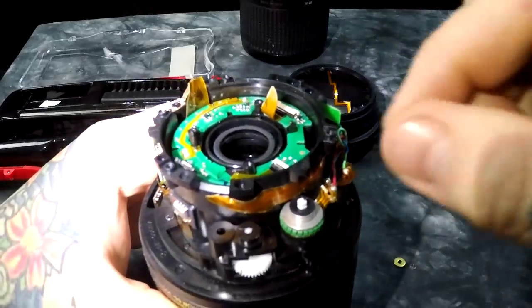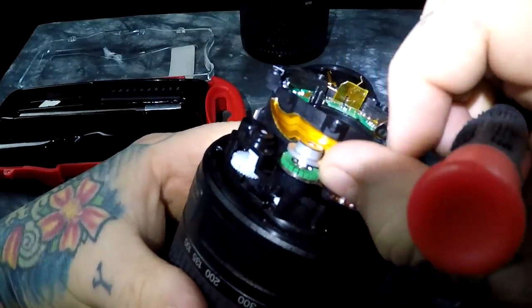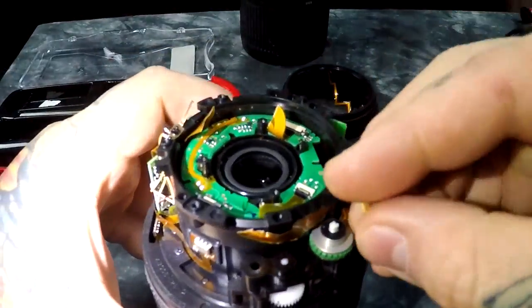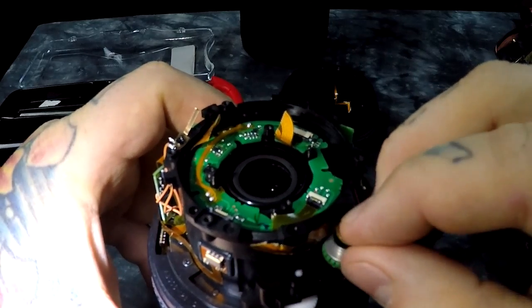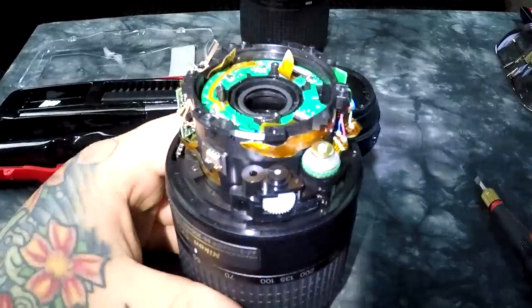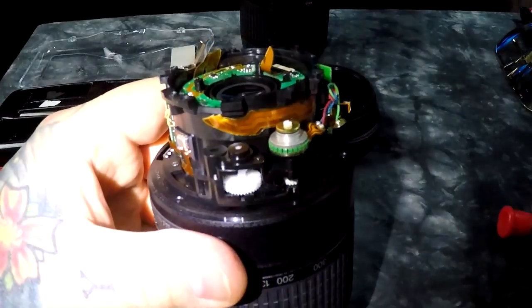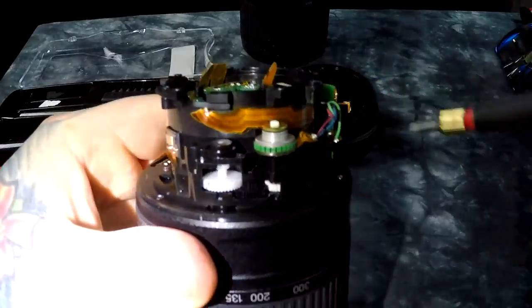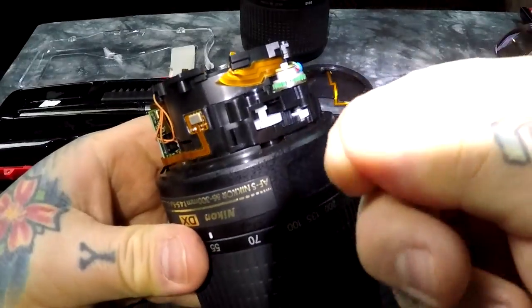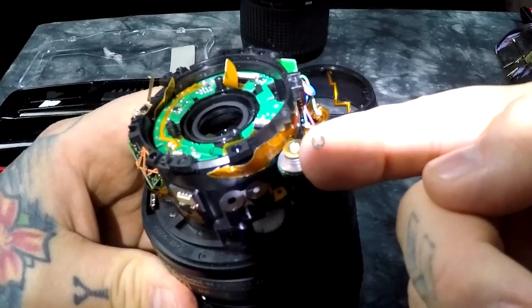On top of the micro motor - the micro motor won't work right now because it's missing one thing, and it's not this piece I can lift here. What's missing is right over here on top of the micro motor. I'm going to place it back on top so you can see it. What causes this lens to fail - even before the cheap plastic teeth fail - is the cap to this, which is a c-clip. See that slot right here? This is an AFS-marked Nikkor, and the only thing that has to be missing for autofocus to fail is this chintzy little c-clip.